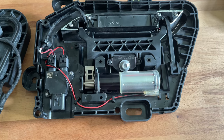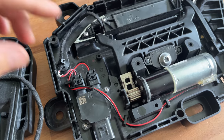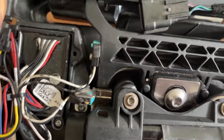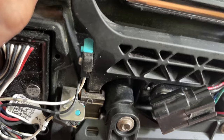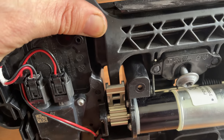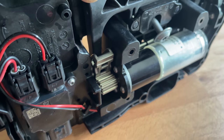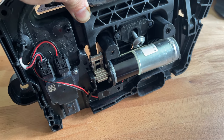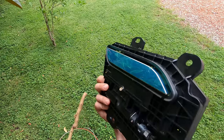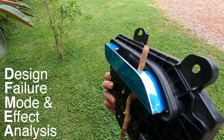This whole new door handle is an awesome design. I can only think of one problem with it: the sensor measures the movement of the handle, not the lever that the motor is attached to. The original design had the return sensor attached to the motor lever. Remember how the handle and lever are not connected so you can't cut your fingers off? Well, if you hold the door handle out and the door decides to retract the handle, it can't — because it won't know when to stop retracting. The controller knows the handle is deployed because it did the deploying, but what if you turn the power to the car off and then pull the door handle out and then turn the power back on? The sensor would read the door handle as deployed. Would it break itself trying to motor the lever back farther than it can go? Did you think of this in the DFMEA meetings, Tesla?